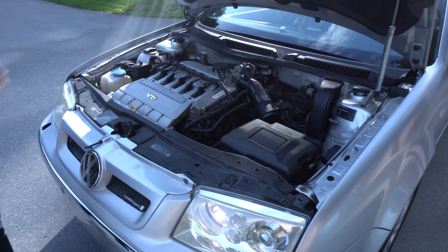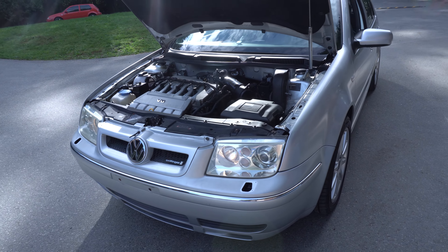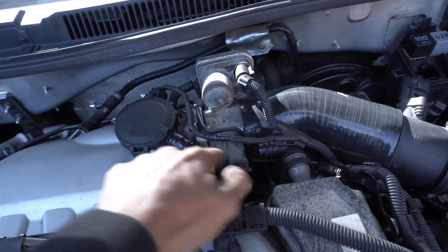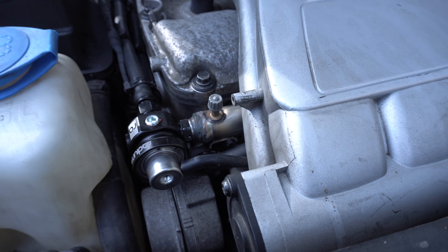The 3.2 Bora is finished - now we've got two 3.2 swapped Boras. We've still got some stuff to do: we've got an 83 millimeter silicone throttle body but it doesn't reach the stock airbox and there's nothing on the market that does, so we'll run it with clamps and a cone filter. We also need a silicone hose for the cracked PCV valve hose - right now it's plugged off. Our Radium fuel pressure regulator setup turned out good despite some pinhole leaks during welding, but that's been sorted. Thanks for watching our 3.2 rebuild swap project!